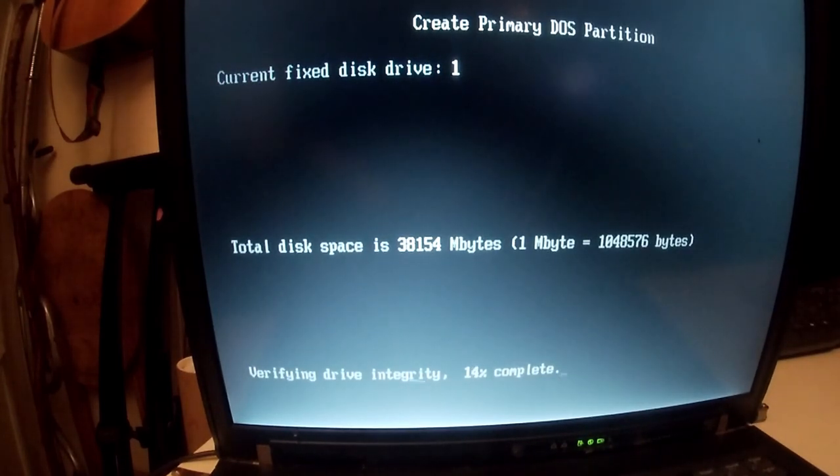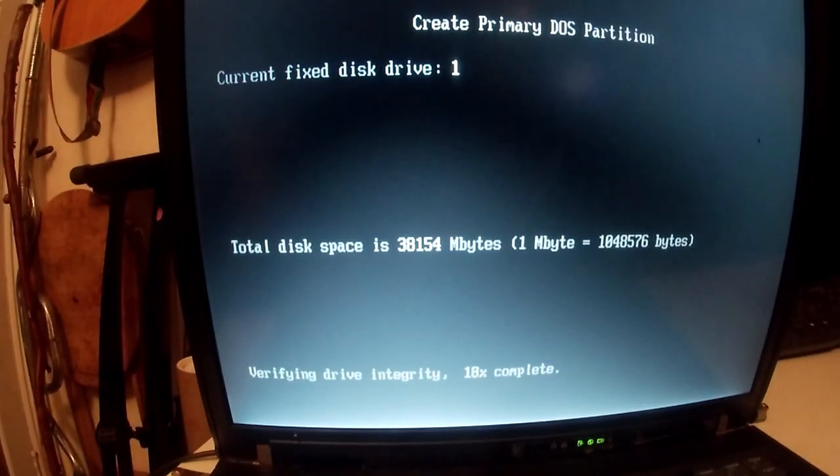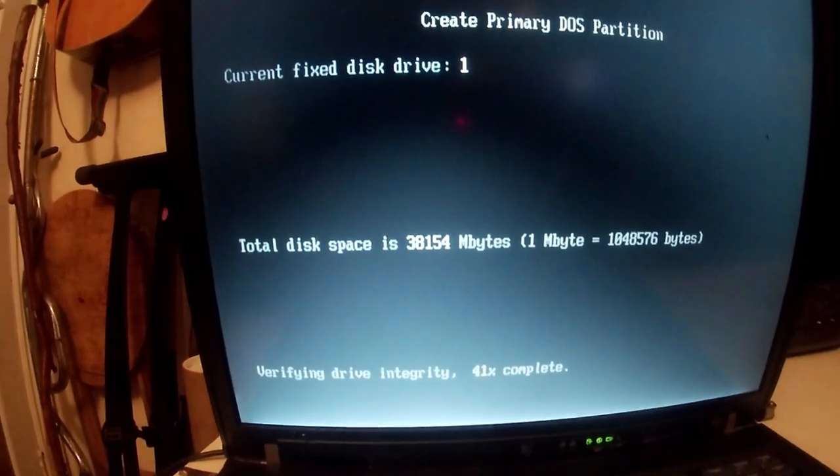I think, so the hard drive that's in there is 40 gig. So I'm thinking, if you have 15 gigs each for Windows 7 and XP, or something around that sort of figure, but we can sort that out when we get to the Linux Live bit later. That leaves, say, 6 gig for our shared files, and 4 gig for Windows 98. So that's what I'm kind of planning on doing. We'll be back once this integrity check is finished.